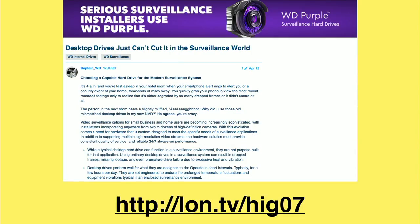The drives also have some ability to alleviate vibration and manage heat, which all goes into long-term reliability. That is why I would say if you're doing surveillance, getting the purple drive is probably the way to go. There isn't much hardware difference between the red and purple drives, but there are firmware differences that make surveillance drives more optimized for constant writes versus NAS drives, which do a lot of reading and writing. If you're using your NAS for both surveillance and file serving, I'd go with the purple drive.